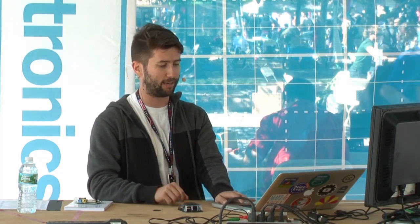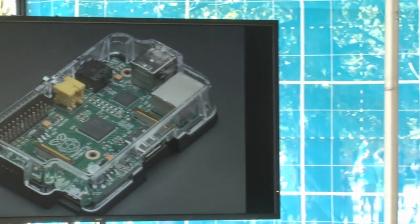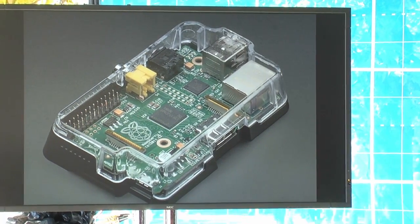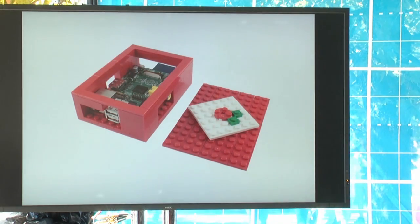The SD card is the same kind you can buy in a drugstore. If you mess one up, you can reflash it or put a new operating system on it, and if you really mess it up you can just buy a new one — they're cheap. Of course a USB keyboard and mouse are helpful so it works just like a normal computer. A monitor — analog or digital — is fine given HDMI and composite out. You don't have to have a case, but cases are nice; they're available from Adafruit, Pimoroni, and the Maker Shed, or you can even make one out of Lego.